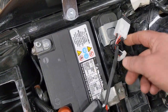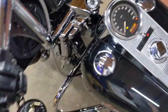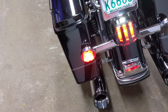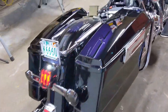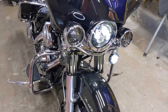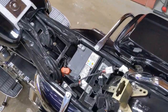That was relatively painless — a couple of little clips and we're in. Before I hard-mount this, let's make sure it does exactly what it's supposed to. We'll put the blinker on — and that is awesome, no more hyperflash. Let's shut that off and check the other side. I'd say that's good to go. The next thing is just to hard-mount that, but first I want to leave the blinkers on for a minute to see exactly how warm these things get.